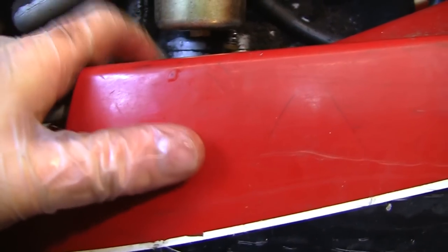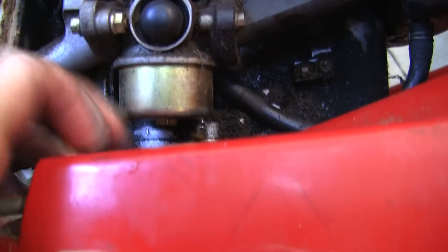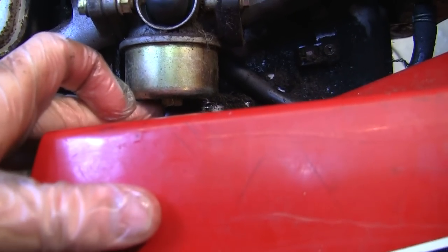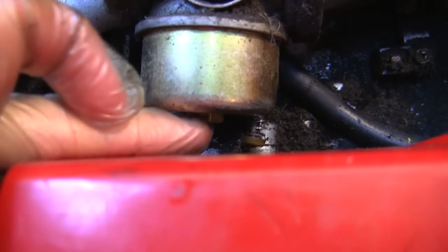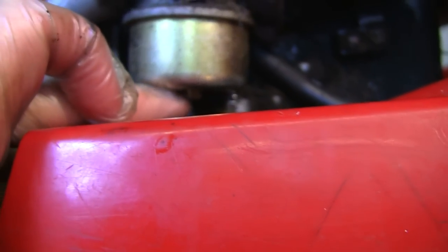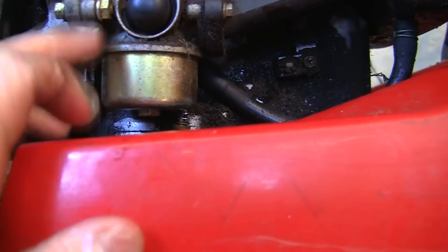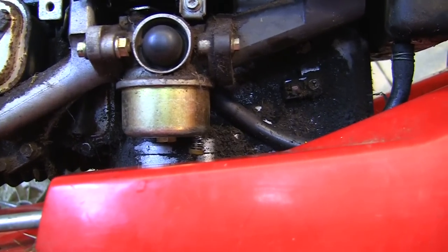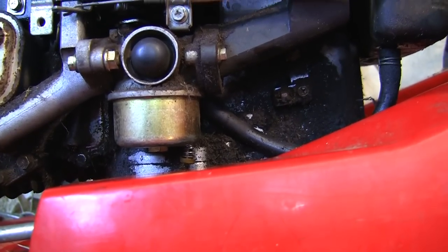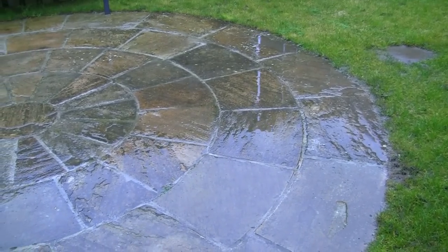One final thing to mention on this is when you tighten this back up, don't over tighten this as well, because you can even kind of strip the thread at the top and it'll break the top of the thread off. When you try and thread it back, if you take the whole thing off, you'll never get it back on. You can probably just see even there, just using a spanner, how it's kind of marked all the flats on this actual bolt. So just be really, really careful with these. As I said, they're not that easy to get hold of the parts either. If you've got one that's complete, I would do everything you can at first, apart from taking it apart, to get the lawnmower running.